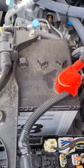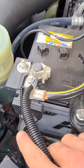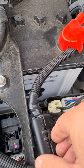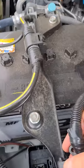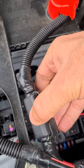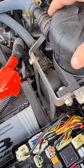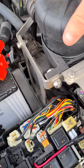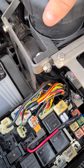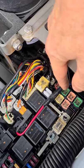Dual battery system — I run 6 B&S cable, negative and positive, and in there is a 40 amp midi fuse on the positive. Obviously this car runs a smart alternator, which is just one of the things you've got to live with now — all the new cars are coming out with smart alternators. I run a RedArc 1225D and it has a blue wire.